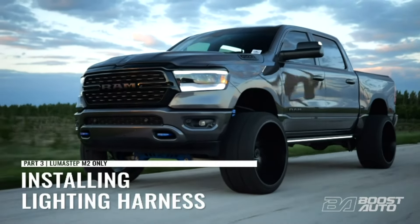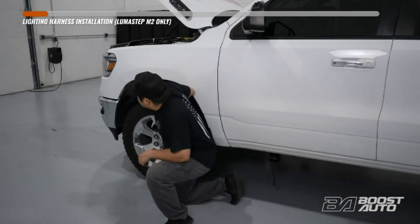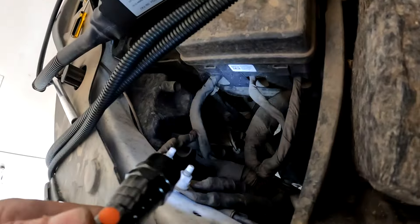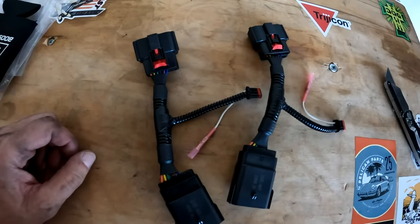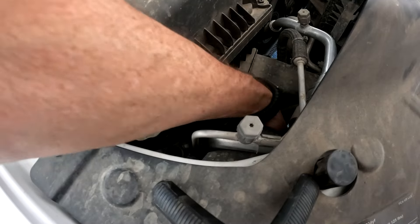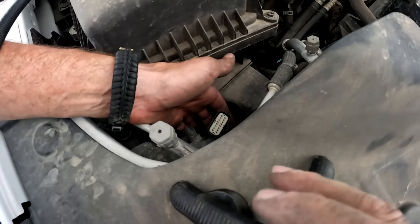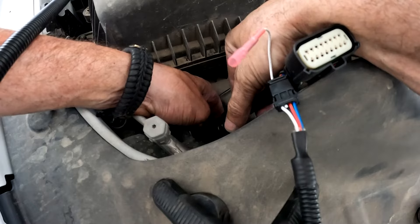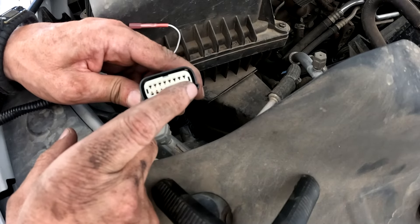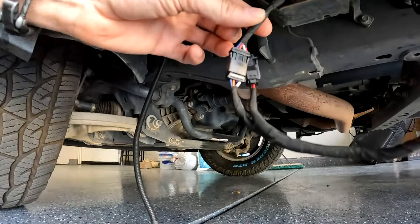You need to access the back of both front headlights. The instructional video has you undo the fender liner, but I got away without doing this, which saved time. I reached through the engine bay — I think I was able to do this because I chose the plug-and-play adapter versus the hard wire, and I'm glad I did; it made things so much easier. You can't see anything down there, but with a light and feeling around, the connector has a small clip release on the bottom. Just connect the plug-and-play adapter and plug it back into the headlight — there are guides on the connector so you can't plug it in wrong. I was confused about this part, but tech support responded quickly and straightened me out. Then everything made sense.